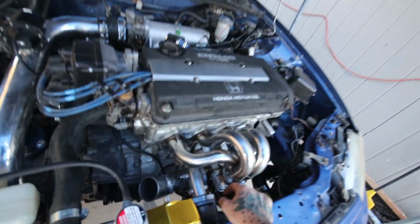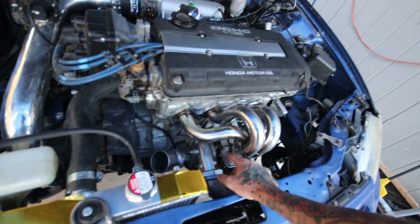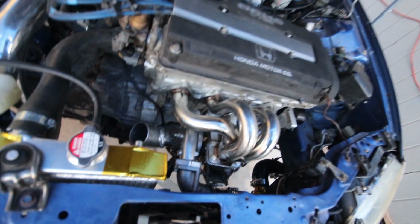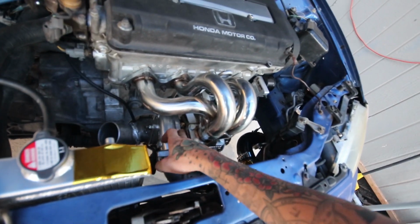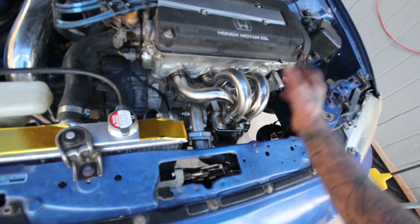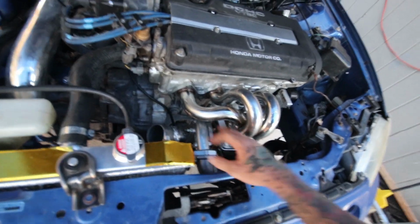This is a journal turbo, or whatever, journal bearing, whatever it's called. So it needed a restrictor because the factory lines that this turbo comes on with the SR20s, they run restrictors in the banjo fittings. Obviously I'm not running factory lines, I'm running -4 lines. So he said a 60 thousandths should be the best bet. So had one made. I'm gonna have to take the whole turbo off the car to tighten that down, but it's in there, so I know it fits.